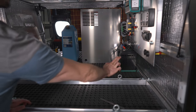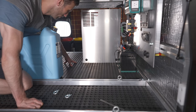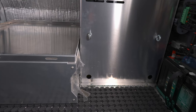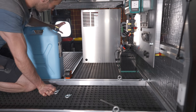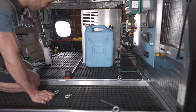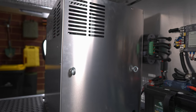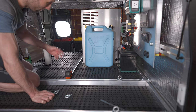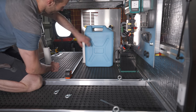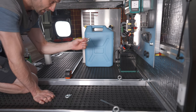You can see how much room there is on the back edge — that's for airflow. I'm drilling two M8 holes on the back and fitting two collared M8 eye bolts. The drawer-shelf combo may protrude about 150mm deeper than the fridge, leaving a small recess or pocket. Since I'm converting one jerry can holder to a gas holder, the car will only have one jerry can holder on the back. I could use these eye bolts to strap a water bottle in that recess — no gas or diesel inside the canopy, water and electricity are fine. There's a 100mm gap from the back of the cage to the back of the fridge — pure empty space for ventilation.